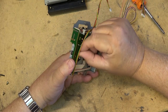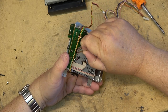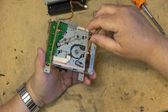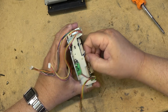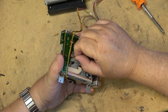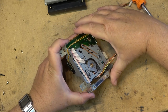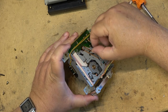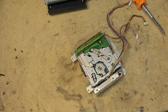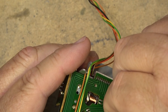Let's run this through its modes and see why it's not working. It might help if I don't knock the belt off. This belt might not have been sitting in its track properly. It's a tooth belt - I think that belt may have been sitting on top of the pulley and not turning. I'm going to go back and look at the footage.